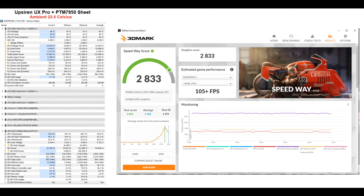I ran another stock-settings test with 3DMark Speedway. It was an improvement but not perfect: CPU was at 76°C max and GPU at 68.2°C, but the hot spot was quite high at 81.8°C. At first I thought I'd made a mistake, but PTM takes a little while to heat up — it turns into a liquid at around 45°C — and then it flows and gets better contact over time, pressing out as much as needed.